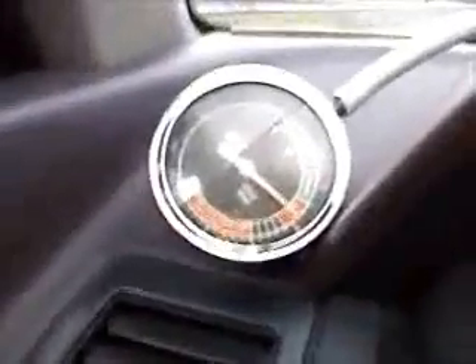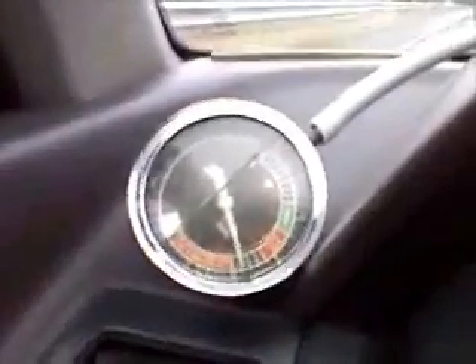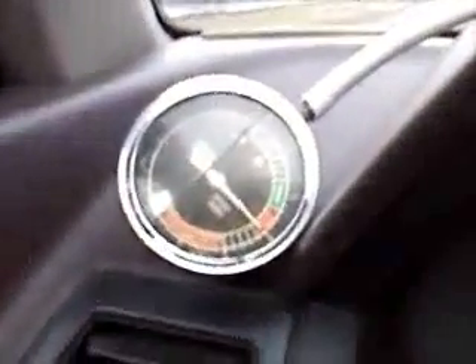Later I'm going to demonstrate how much of an impact these wild vacuum fluctuations have on the way the cell behaves, because we have trapped airspace inside the cell and inside the bubbler. As vacuum decreases in the intake manifold — if we have it connected without a check valve or one-way valve — what will happen is the residual vacuum in the cell and in the bubbler is actually going to pull gas backward, back into the cell, until the cell can generate enough gas to overcome that pressure.